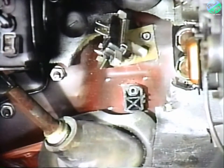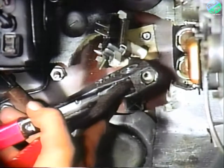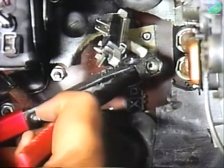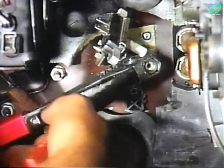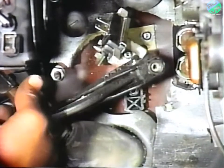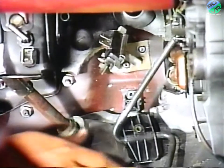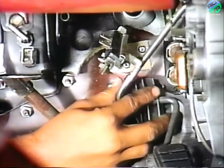After installing the new heater core and proper hose quick connect configuration, use the two supplied pop rivets and reinstall the AC wide open throttle bracket and cutout switch if equipped. Now reinstall the accelerator pedal.